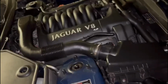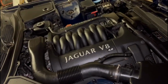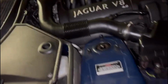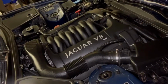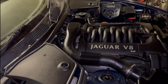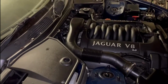So I've changed the oil, changed the filter. I haven't bought particularly expensive oil, but it's correct oil. It's 5W30. I can't remember the spec off the top of my head. I'll put it in the description, but I will change it again once we're a bit further down the line. I've checked the coolant, and the coolant is very clean actually, considering how old it is. So I think we are ready to crank. I have checked the engine is free, which it is, and the spark plugs are still original. So I think we're ready.